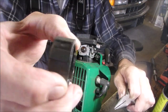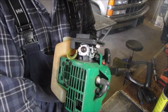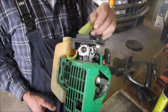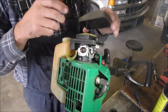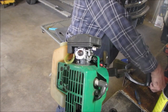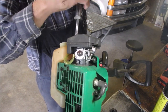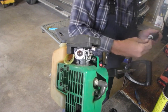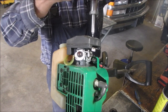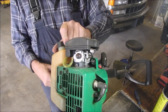Sometimes these leak. I've got a few of these around, so I'm just going to go swap one out with the other machine — I've got this identical machine as a spare, that runs! I should probably try it again with the air filter on, because the air filter acts like a mild choke. Every time I work on a small engine, two-stroke or four-stroke, I mention that the air cleaner is like a choke.